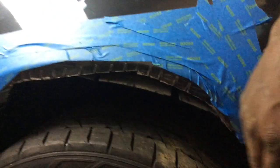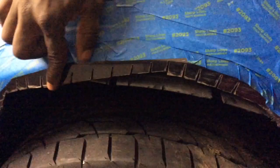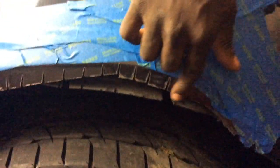All right, guys, real quick, another thing I want to show you. Typically, most people do this with their wheels off. So if you don't trust yourself with cutting tools, take your wheels off. I just jacked mine up so I can reach it pretty good. But anyways, with your fender liner, make sure you cut some slits in here. I cut this in a triangle shape so I can fold some of these up so it can reach up here, okay? Because it's gonna be a struggle. Same here, I did the same here and here, so I'll be able to actually push it up.